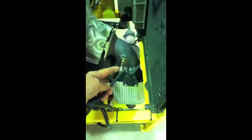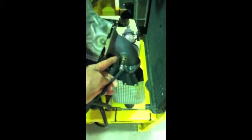Now this is how the oxygen sensor might be installed on a vehicle, where it's below the exhaust manifold and above the catalytic converter, and it's going to tell the computer the rich and leanness of the fuel based on a voltage that it sends out to the ECU.